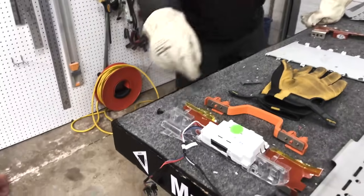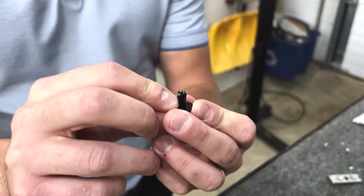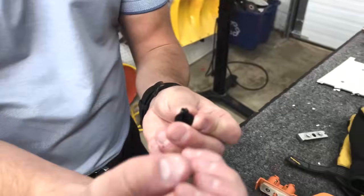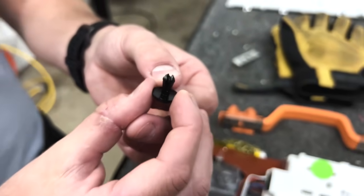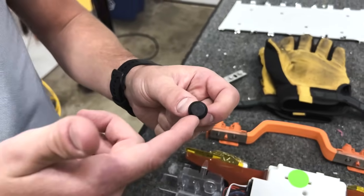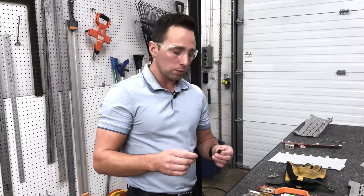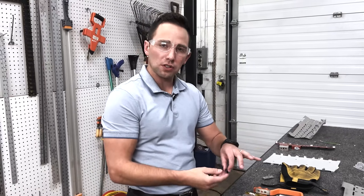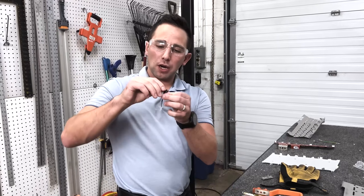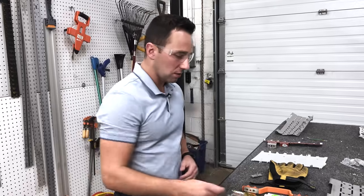It was also held on by these little black fasteners — these would be referred to as a two-stage push pin. If you look at the bottom of it, there's a center post that comes out, and if you push it in, it expands those barbs — think of it like a drywall anchor you would use in your home, but this is just a push pin with no threads. This is something we've seen literally thousands of times on different trim applications — to me this is an off-the-shelf push pin typically used for trim. For Tesla owners or anyone with an EV, pop open that hood and take a look at all the shrouds around the frunk — you'll more than likely see a dozen or so of these. The nice thing is if you pop off the top portion you can pull it out, no harm no foul, take off your panels and put it back. Kind of interesting that they use this in a battery module application.